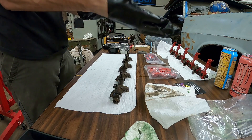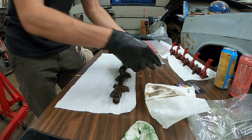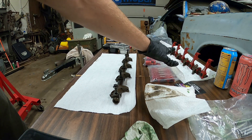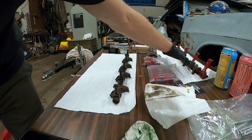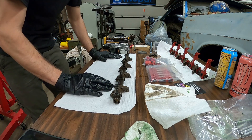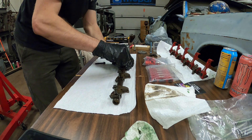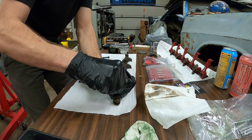This will be a demonstration of exactly what we're going to do here. The idea is these stabilizers and these collars get used on the shaft. As you can see over here, we have the exhaust rocker shaft assembled — this was just to make sure I had a complete understanding of how to do it. Now I'm going to show you guys exactly what to do. I have it laid out here. You can just pull these bolts right out. I like to set things in the exact orientation that they are as they lie, so when we pull them out we lay them down as such.